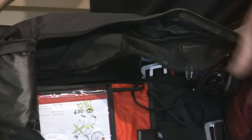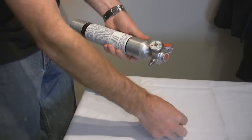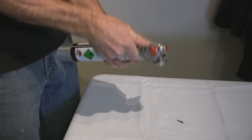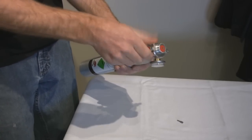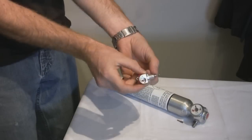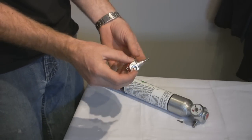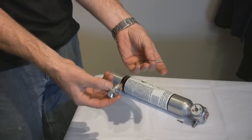This airbag is now ready to have another cylinder. Here's the cylinder — this is the firing pin which got pulled out. The only tool you should ever need with this is a crescent wrench. I'm going to open that up. Inside of here there's a piston with a little O-ring on the end. This O-ring should be changed every time the cylinder is blown, so that it doesn't leak over time. We sell O-ring kits, and it should be changed before the cylinder is filled.